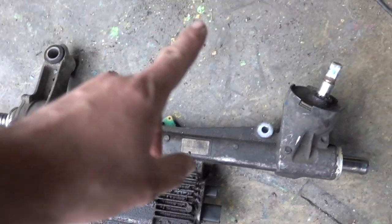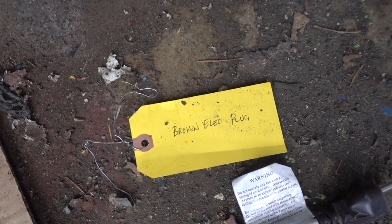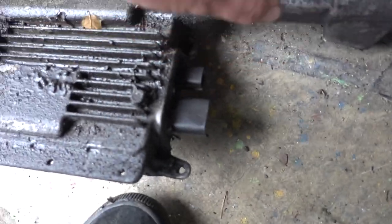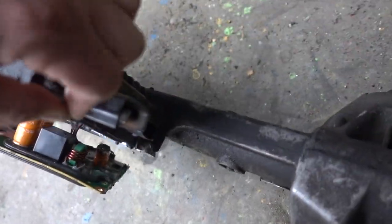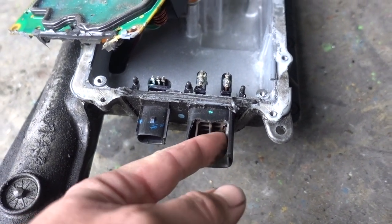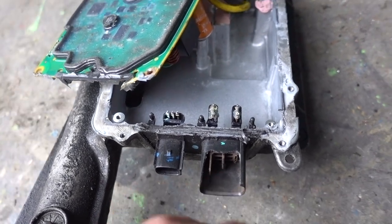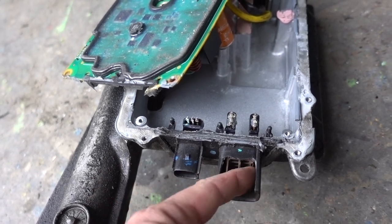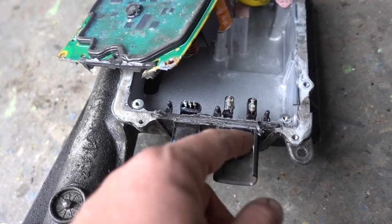I got a new rack from a vendor on eBay and they didn't seem to mention that the electrical plug was broke. This is the old one. What happened with mine was I don't run any kind of plastic covers under my car, so I wound up getting a bunch of water inside of the harness and this prong actually decided to melt away because there was so much water in this connector. Pulled it out, cleaned it all up and didn't even realize that this was gone until I started looking a little bit closer. I thought there was just some sand and dirt in there, but it was actually the pieces of the prong that were kind of just broke off.